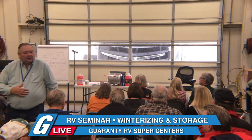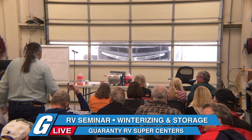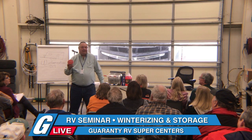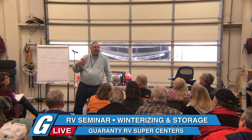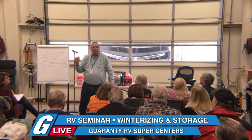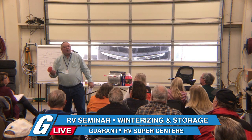Yes, sir. Earlier, did you or did you not say that that filter will prevent the oatmeal in your tank? I can neither confirm nor deny my statement. But the truth of the matter is, if you have his big blue outside whole coach filter, it will take out 90% of the oatmeal. All the hard water deposit, most of it will. It won't get the Montezuma's revenge, the bacteria and the sulfur smell, things like that, because those are too small to get picked up on these macro filters.